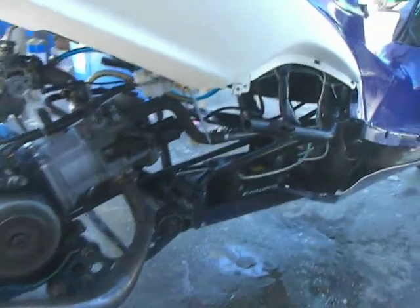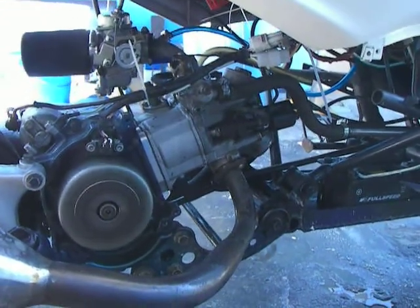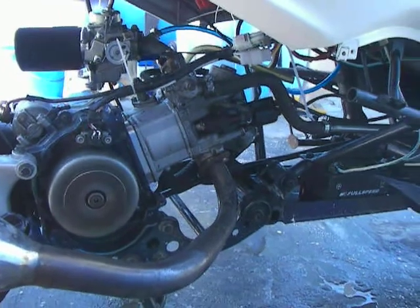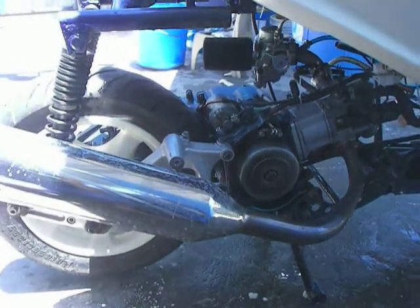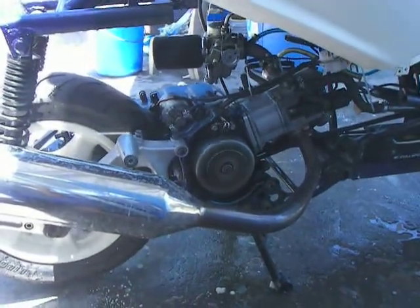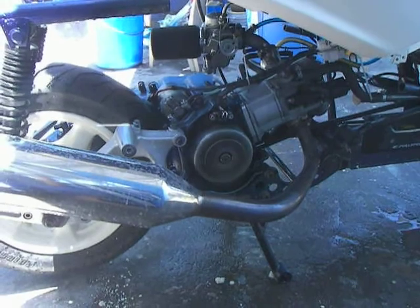They're keeping an eye on the temperature. The cooler lines actually helped it along. We actually deleted the thermostat — it's just got a restrictor plate on it, so it only flows at a certain temperature. Average temperature seems to be between 85 and 90, depending on the temperature of the day and how hard you're running it. I've had it on the open highway at full throttle, about 85 to 90. It just goes up and down depending on the headwind and the temperature outside.